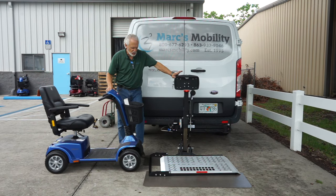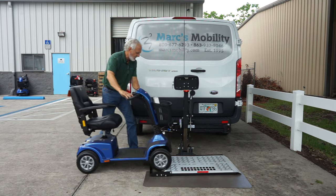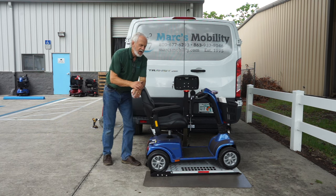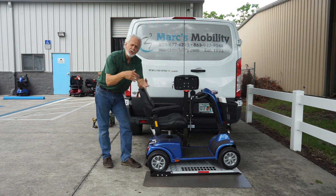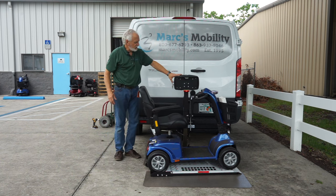We have the platform down. I showed you earlier how to extend the gap — this is a large 10-inch wheel, so you want the gap to be at least this far, because when you bring the scooter on, you go forward and the back wheels will be in that gap. It's usually recommended to lift the scooter when you run your car, because your alternator will send more power to your battery. If you have a low battery and don't run your car, you may not get 12 volts, and this lift needs at least 12 volts to lift. So run your car, then go up with the lift.